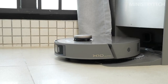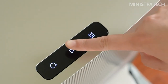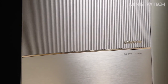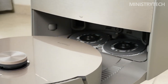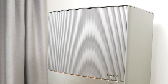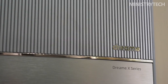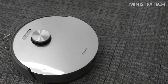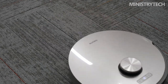To compare the battery life of the Dreame X10 Ultra with the previous generation Dreame S10, the clean water tanks of three robot vacuum base stations were filled to the max scale line, all sewage was emptied, and the hosts were fully charged to 100%. The default sweeping and mopping mode was enabled for whole-house cleaning, with suction set to standard, cleaning times set to once, and base station cleaning at default settings. The cleaning coverage rate of the Dreame X10 Ultra and S10 was higher and took longer. The overall cleaning effect of the Dreame X10 Ultra was relatively good.